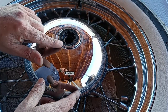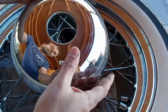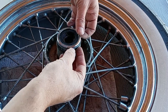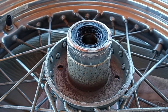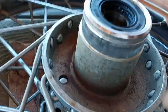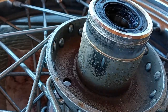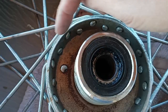Once you get it up to the level of this part right here, you're gonna have to just get in here with your hands and wobble this thing off. There you go — this thing's free. Once you do get it free there is a little rubber ring on here that you should look out for. For this video I'm using an extra rusted wheel, just so you get an idea of what it looks like in case you're thinking about taking your hubcaps off. If you come in here and polish this up it should look fairly shiny, and you can see where all your spokes are wired in along the outside.